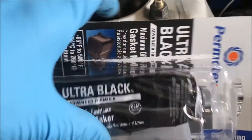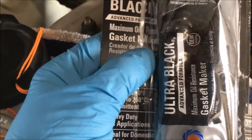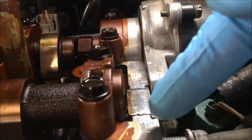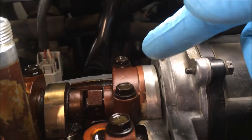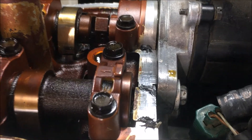This is what I'm going to use as a sealant — it's Permatex Ultra Black. It's oil resistant and high temp. The Toyota manual calls for putting it there, there, there, behind, and the same over here — there, there, there, and behind this bearing cap. That's how much RTV sealant we put on right there.